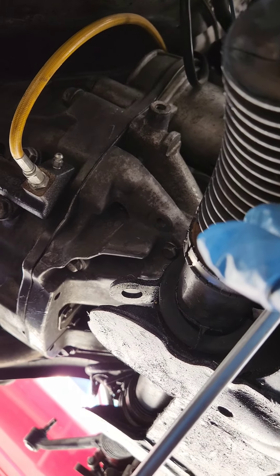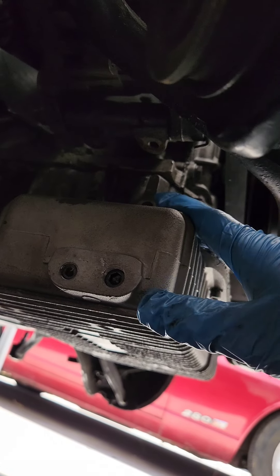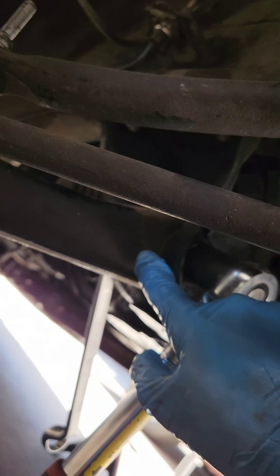Unfortunately there's not enough room to get the rack out — it's hitting the engine all over the place. I decided I'm going to drop the subframe. I've actually done this before on this car because the upper oil pan gasket seal was leaking. The way I do it is unbolt the LCAs from the crossmember, unbolt the tension rods, then lower the subframe down. I have an engine holder tool I'll put on top, loosen the motor mounts, and the engine will be hanging while I drop the subframe. The bolts and nuts are 22 millimeter — I have angled wrenches to fit in there better so you don't strip those. S12 parts are not easy to come by anymore unfortunately.